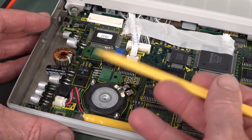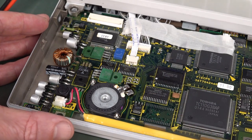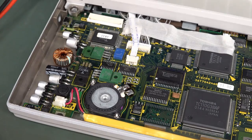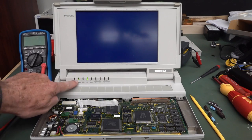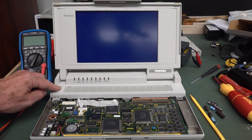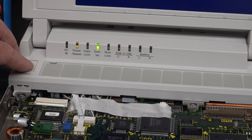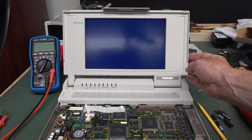I wouldn't suspect the switching transistors - we're not talking about a really high-powered thing here, so there won't be huge thermal stresses on the switching regulators. First pass: if you find dead electrolytics, replace them, then repower it before going further. So let's go - without the battery, without the hard drive. Power... speed. There's a flashing - is that normal? Yay, there we go. Power, speed, overlay - red, green. The floppy's doing some seeking, but it should boot up to DOS in ROM and I'm not seeing anything on the screen.